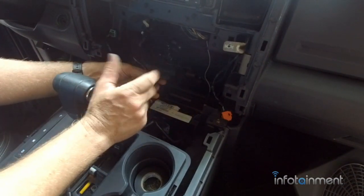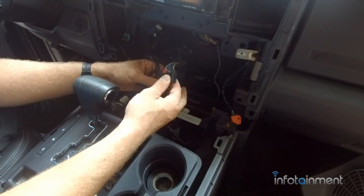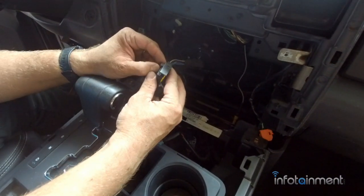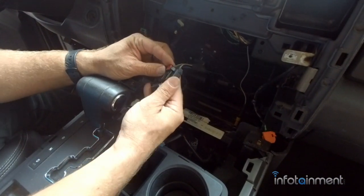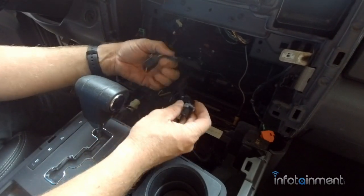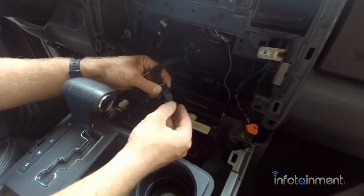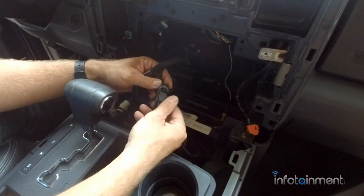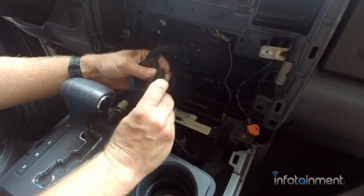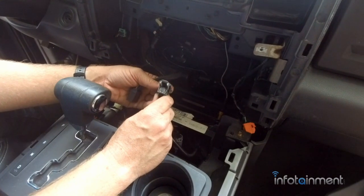At this point we can tuck things back and use a little more zip ties if you prefer. Now we'll reinstall the dash and the center console. One thing I did want to mention: on the back of the bezel there's a little red tab on one of the connectors — you have to pull it up first because usually it's locked down. So pull it up, push it in, then the connector comes out. This little lever here goes back and forth as well; when it's in its lock position, push the little tab in, slide the gray lever and it comes out. Do it in reverse whenever you reinstall the bezel.